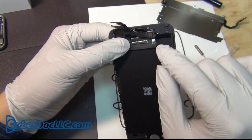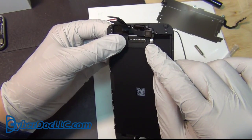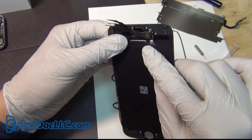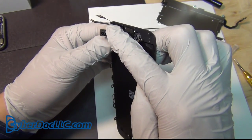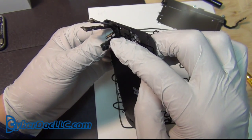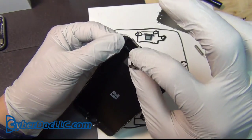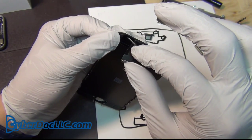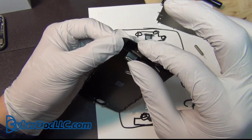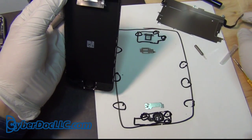So this is the LCD screen. It has a backlight here — you can always jump in here if you want to fix your backlight, aside from the larger board repair. This is the phone face camera, which is kind of small-ish in my opinion. This is the camera ribbon, this is the LCD, and that's the touchscreen ribbon cable. And as you can see here, that was the home button — I didn't know.